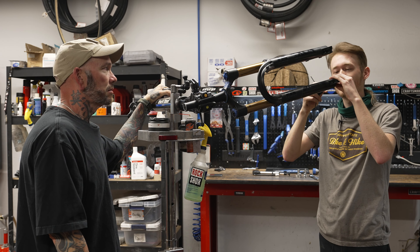The rebound knob on a Fox 36 has a little set screw — they all pretty much have a little set screw. Once you pull your rebound knob off, that nut is exposed. You're going to be able to get access to that — remember, expose your nuts during the fork service.